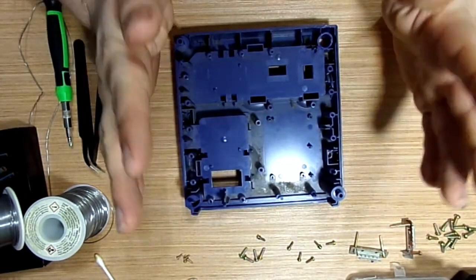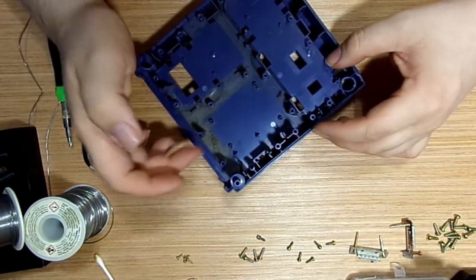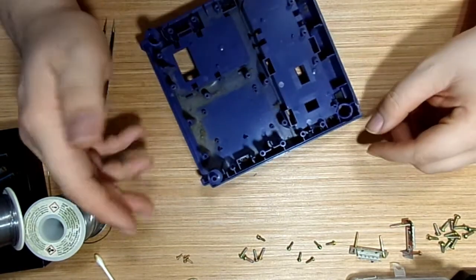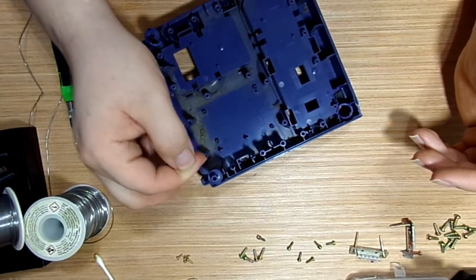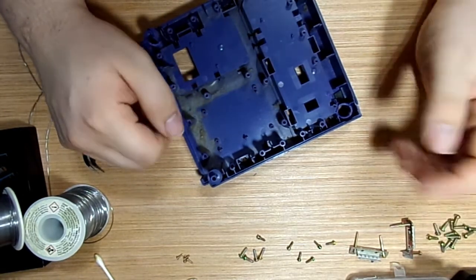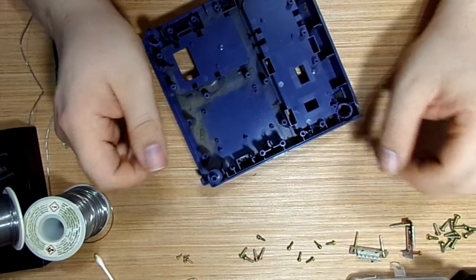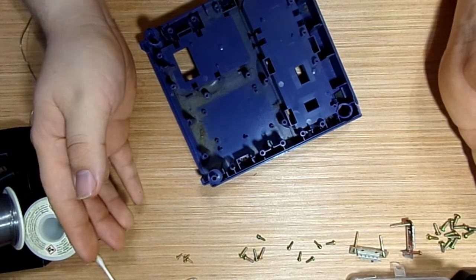I use hot glue on a lot of things, but something like this, where it's so small and precise, such as the screw post, which I'm going to try and fix, as long as I have all the parts laying about in my little tool thing over there, I'm going to try and fix them up. If I use hot glue, it's going to get in there and make it nearly impossible for me to get the screw in and out. Super glue, if I let it set, as long as I don't get it inside the thread area, should work really good. Normal super glue, where it's liquid, not a gel, if you use that with baking soda, you can actually rebuild these up. I'm not sure how you would tap them, but...